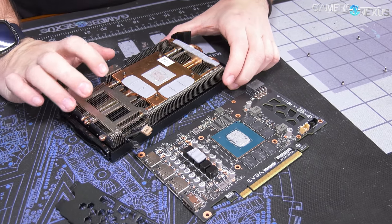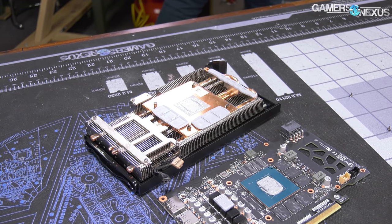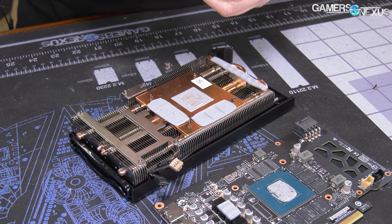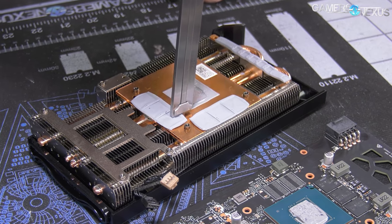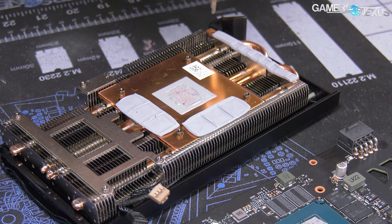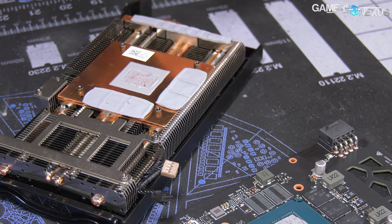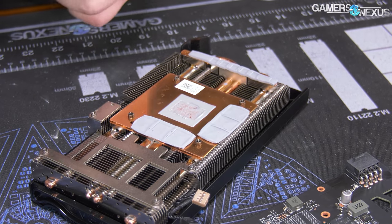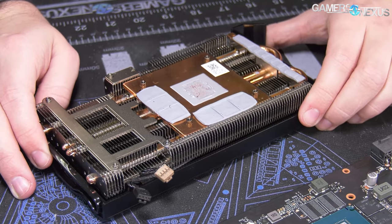Internally, we've got some thermal pads. Let's measure the thickness on those — in case anyone ever does maintenance on this in a few years, we'll get you the thermal pad size so you can replace them. Size on these is two millimeters, and that one's maybe 1.5 — harder to measure. Heat pipes look like they're six millimeter heat pipes — very simple design, and not as much heat to cool on this. It's about 170 to 185 watts depending on the OC condition.